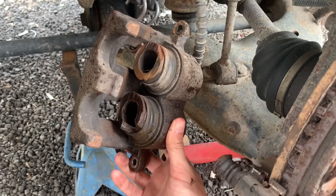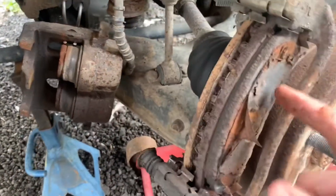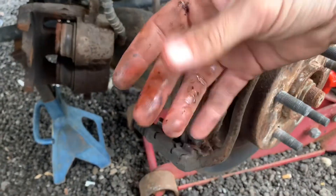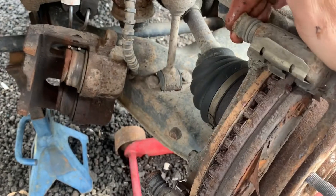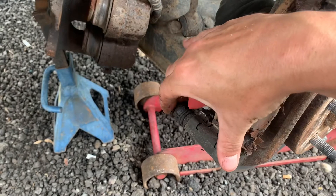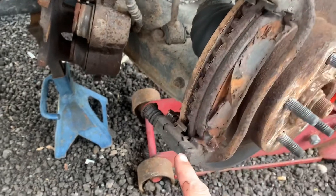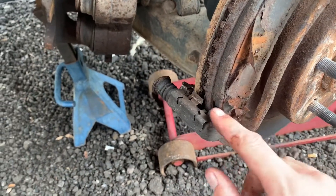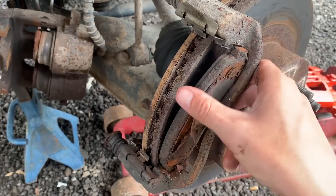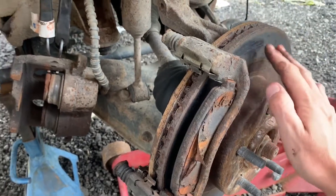Wow, and there's another chunk missing there. There was no pad at all on the inside — there's the outer pad to push on the rotor but the inner pad is just gone. Brake fluid everywhere. You want to make sure these adjuster sliders aren't stuck — they seem to be okay. The new pads come with new hardware, these stainless steel sliders. I'll pop out the old pad — the other one is non-existent. The rotor is not bad, it's not good, but it's not bad.